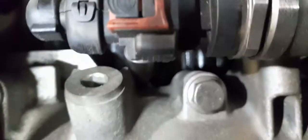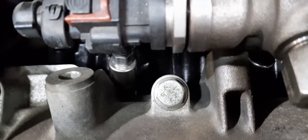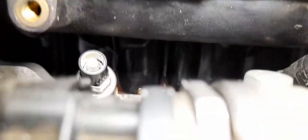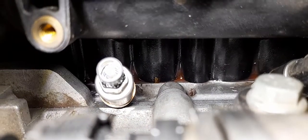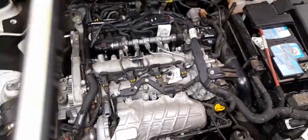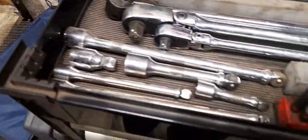The engine is going to have to come apart anyway if we fix it. It's hard to see on camera because the light's terrible — you can see we've got water down in there near the glow plugs. That's because either the seal's gone in the manifold or the manifold's cracked, so that's going to have to come off if the engine's any good.